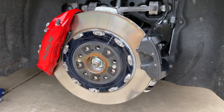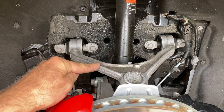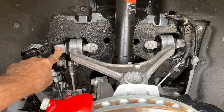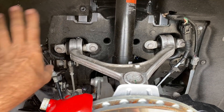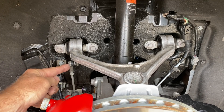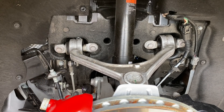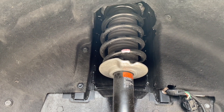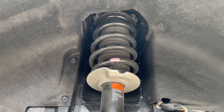We have two brakes back here but the really interesting stuff is hidden behind them, so let's zoom in closer. Here is a forged aluminum upper control arm which really catches your attention — look how it's mounted. This is a cast aluminum piece, and the dog bones are set deep into it, which is really interesting. You can see this cast aluminum is welded to other members here and here to make up the chassis. This linkage feeds into a sensor mounted a little bit lower, telling the computer the position of the suspension at any moment so it can make decisions about damping force. Here's the rear shock absorber — another magnetorheological damper like the front — and it's a coilover, but the mount is way up in there because this is a mid-engine car with high shoulders, giving them room to move it up.